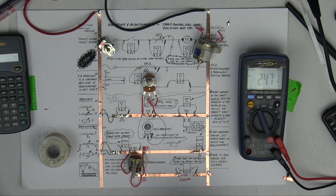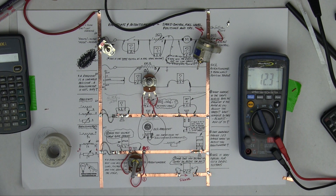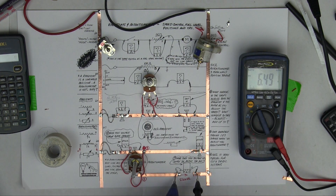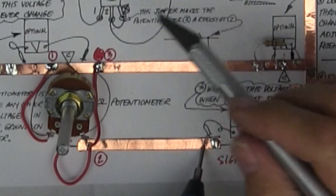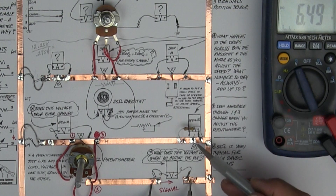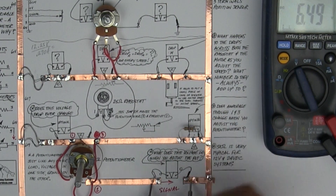Now here's why this is important. Corrosion will make the machine look like something horrible is happening when it's not. I have a normally functioning circuit reading about 6½ volts - the position sensor is exactly where it's supposed to be and the computer is reading exactly what it should. But watch what happens when we put corrosion resistance in this circuit. Voltage drops have to add up to source voltage, so the only way for this to be correct is for the voltage at this position to be exactly right. But this extra resistance is going to affect this voltage drop.